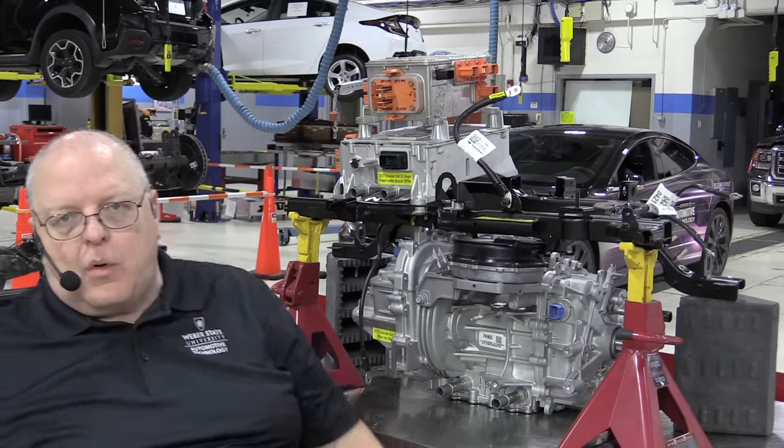This is the Onboard Charging Module — as you can see it is also liquid cooled. On the driver's side it has three electrical connectors: the bottom one is AC voltage in from the charge receptacle, the black one is low voltage for control, and the top one is DC output that goes to the under hood distribution module and then charges the high voltage battery on the smaller of the two orange connectors on the battery. Now I'm going to put this onboard charging module up here on the under hood cross car beam.